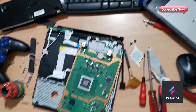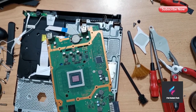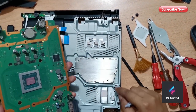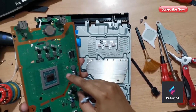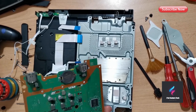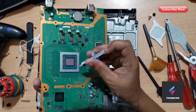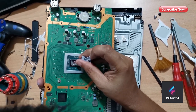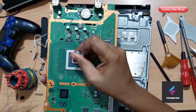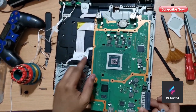I'm almost done cleaning. Now I need to apply the new thermal paste — the Arctic Silver 5. I chose Arctic Silver 5 because there are lots of good reviews about it. If you have another good thermal paste, please comment below. Add some thermal paste onto the APU. Don't worry if you add a little more — even if it spills slightly outside of the APU, that is not a problem.